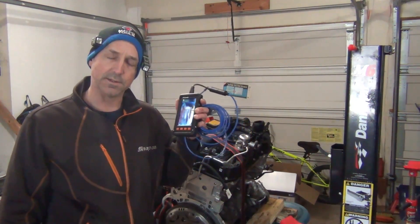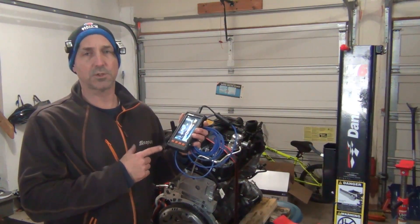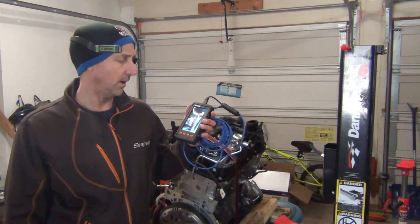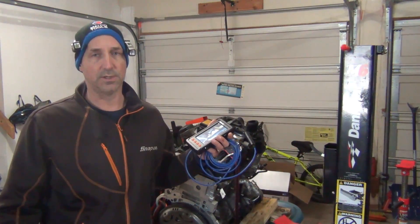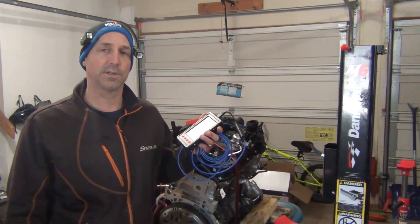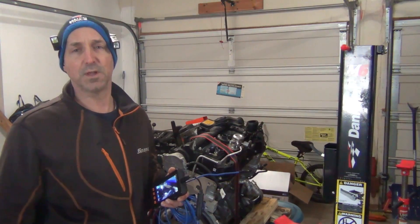The best way to check your timing chains on an N20 is to pick up a borescope like this, put it down the oil filler, and take a look inside to see if you're having a timing chain failure. Take some pictures and send them to me at AskTheCarExperts.com. If you see any broken guides or pieces, you probably have a timing chain failure and should get to the dealer for compensation if your vehicle applies for that class action — I have a video on that which I'll link. Thanks for watching — we're going to be taking this engine apart and I'm excited to check out the failure with you, do engine measurements, and see what the internals of an N20 look like.